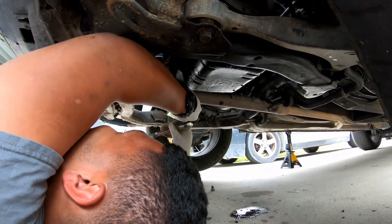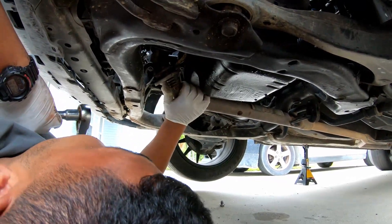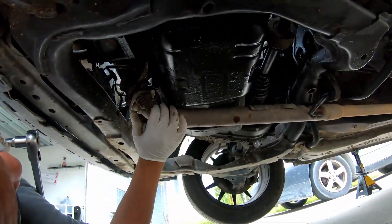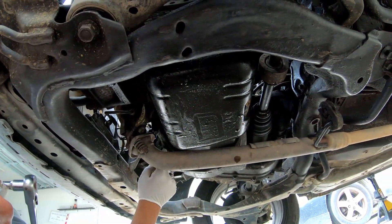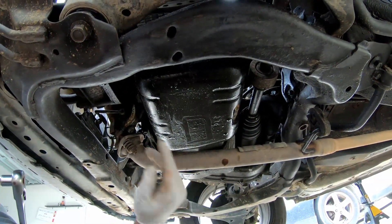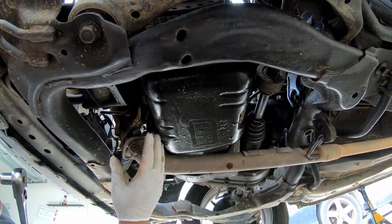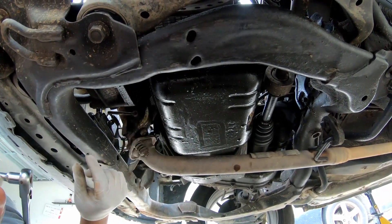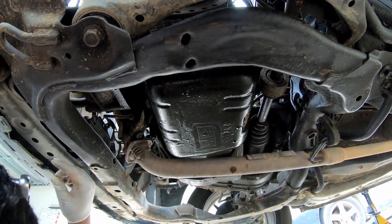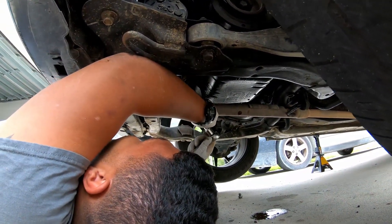Alright, so the plan down here: we have dropped the exhaust pipe out of the way, we're gonna kick it to the side, and drop this pan. First we gotta hit this brace, get this brace out of the way, unbolt the pan, get our first look at the crank, see which bearing is giving us problems, and just swap it out. Hope for the best — hope uncle rodney don't stay.